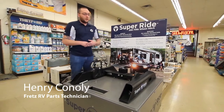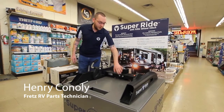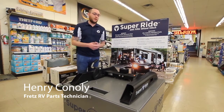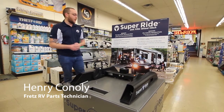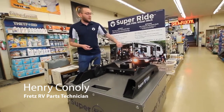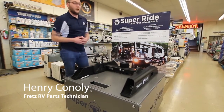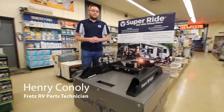This hitch does sit down onto a 30,000-pound rated gooseneck ball. It is designed to use that single-point attachment and eliminate obstructions within the bed. It is rated for 5,000-pound vertical tongue, 20,000-pound gross vehicle weight, and is adjustable to 17, 18, and 19-inch height.